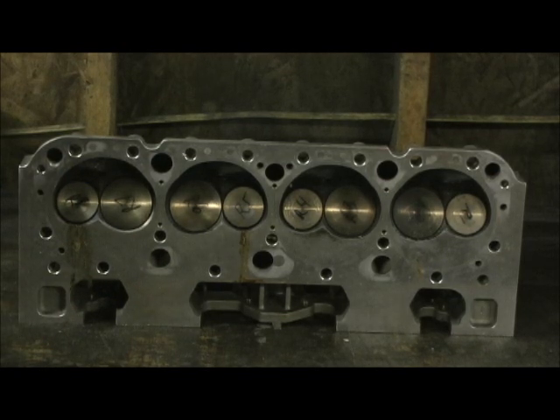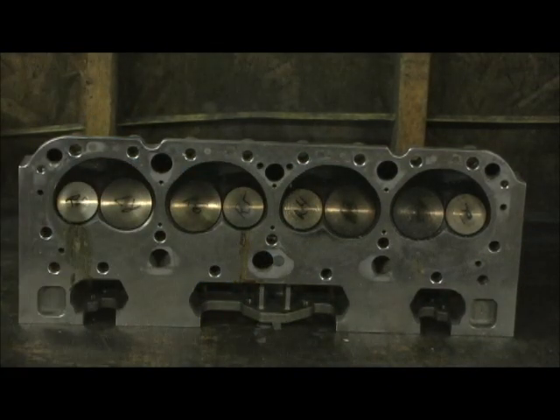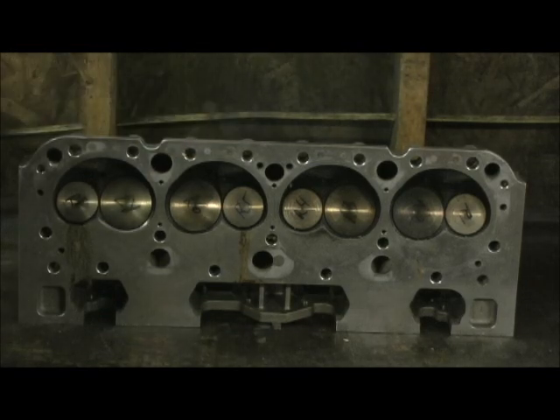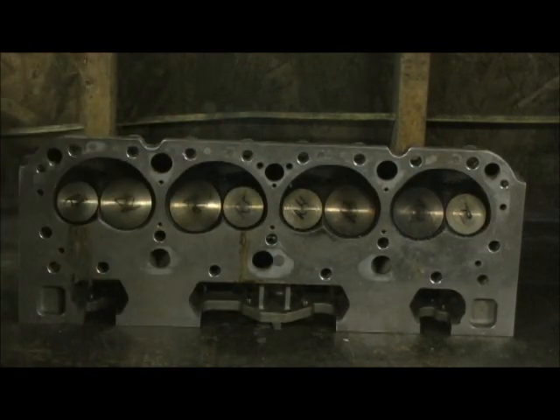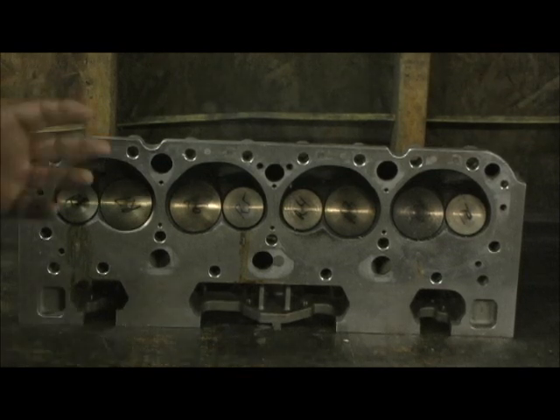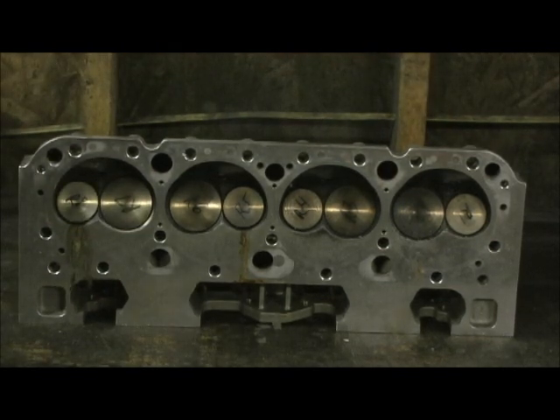It was just a hair away from sticking, and some of them were a little loose. Right now you can see this one and this one — the fluid's starting to puddle up, and this one's leaking. These are out of the box. The valve seats on some of them are over 150 thousandths wide. This is why you order the heads bare with nothing in them, because they've got China valves. My favorite valve for the best bang for the buck is SI valves. They'll get you into a good EV8 stainless or even higher quality if you want to spend it.